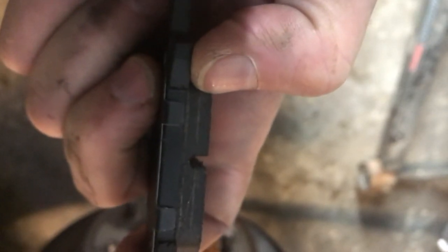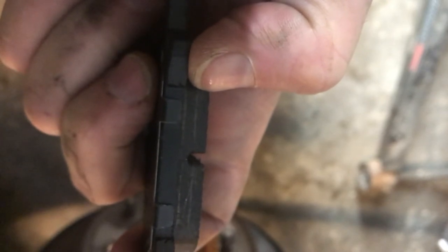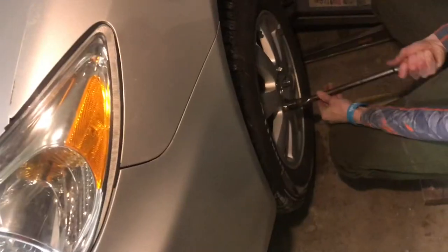You could say, while the tire's off, let's go ahead and change the brakes. Or you could keep driving it and wear about half more off. Right now it's the middle of winter and I don't have any real long trips planned, so I'll run these brakes a little longer. If one brake pad was really thin, I'd replace the brakes. Now the rotor itself has pits on it — I'll wait till spring and change the rotors with the pads.